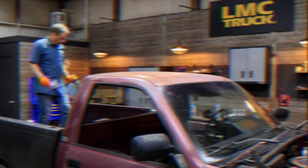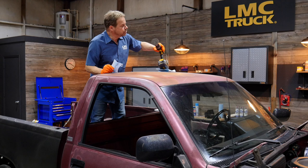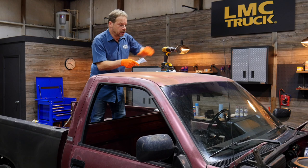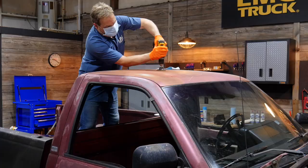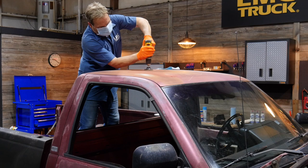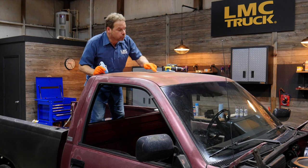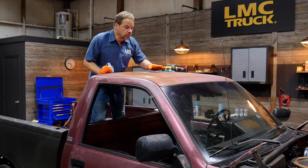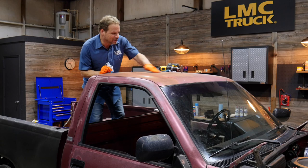It's not uncommon to have light surface rust on a vehicle this old. We've got some stuff on the roof. One of the easiest ways to prep for this is by using a fiber wheel or a stripping disc. We've got ours attached to a cordless drill. Remember that when you're stripping large areas of a body panel down to bare steel, you want to protect the metal — either with a primer within about an hour, or with some sort of a surface treatment that creates a barrier between the bare steel and the atmosphere. That way you don't have flash rusting to fix again later. That did a really nice job of getting us down to clean metal with no pits. We've got a strategy to strip all of this surface rust down to bare metal with a cordless drill and a prep disc. We might burn through a couple of batteries, but hey, that's still easy.